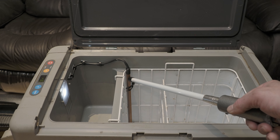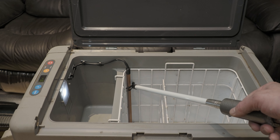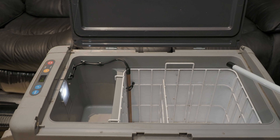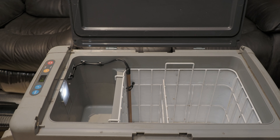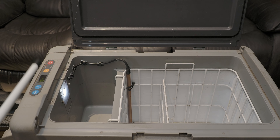I've routed the cable out and down, and installed a copper pipe inside here. The thermistor tube goes all the way down to the bottom and I've just cable-tied it to the little cage inside. If I need to take the cage out to clean water or whatever from the bottom of the fridge, I can just cut the zip ties and lift it out to the side — the little cage will come out without any drama. This has worked absolutely flawlessly.